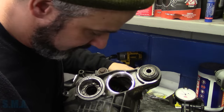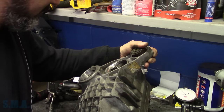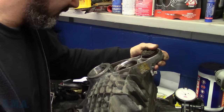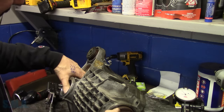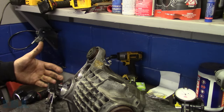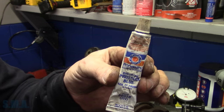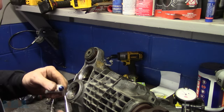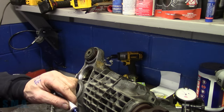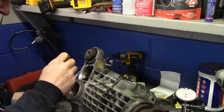It does have some gear oil on it now. Okay, let's do that. And we'll spin it in the forward direction and see what we have for a gear pattern. It should be good. Unfortunately, like I said, I could not measure any of the backlash prior to taking it apart because this bearing had come loose. So I've got some gear marking compound brought to you by Permatex, not a sponsor. We're going to put it on an acid brush. It's kind of like toothpaste. And then I'm going to paint up my gears.